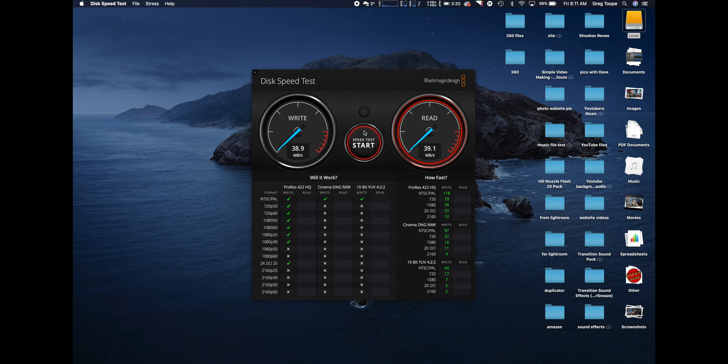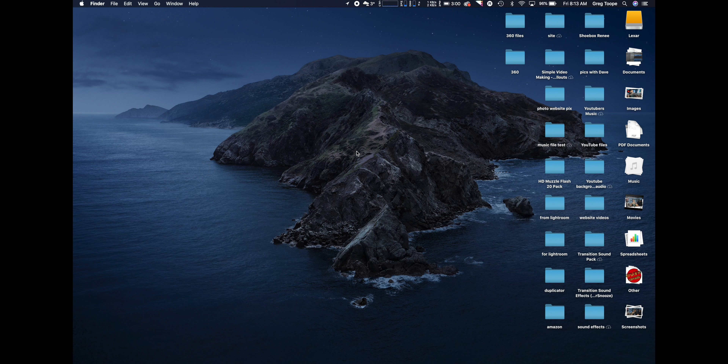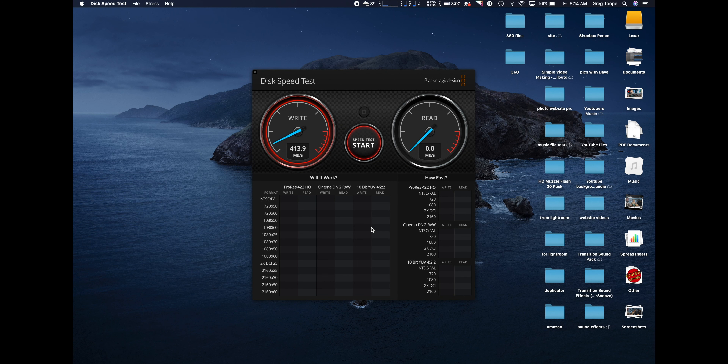Well, that's not right. What's happening here? That's a little bit on the slow side — 40 megabytes per second. It's not even standard hard drive speed. Let's check this out because that's not right. Let's do an erase on this drive — Lexar exFAT. I'm going to eject it and plug it into a different port just to see. Back again — because 40 is not good. Running BlackMagic again — select Lexar target. Okay, that's better. I don't know what was going on.